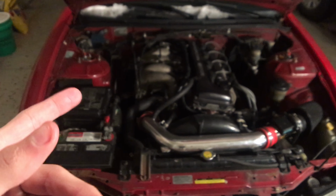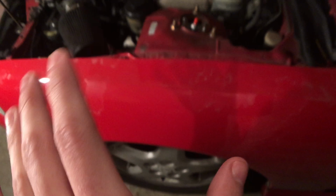I had the same problem on my E46. That's why I went back to my stock camber plates or top hats, because with my camber plates, the top wouldn't loosen, but the collars that adjusted the ride height would. So then my car was getting lower. I didn't film at the Bender meet, but in that picture my car was way lower and my fitment wasn't very good because it was lowered from that. But yeah, I'm gonna stop rambling.